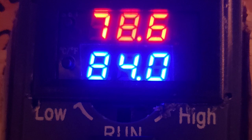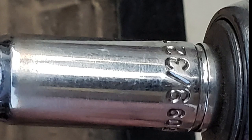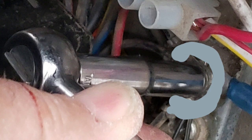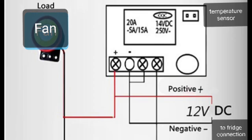You can see how I modified the box so that the new thermostatic control could sit right inside there. Before I got the thermostatic control I just had an on/off switch — that's that red switch right below it. That's the size socket I used to hook it up to the circuit board on the refrigerator. The power went under that white connector, then the ground went under that screw or nut. That's the schematic for the thermostatic control and you can see it can handle up to 20 amps.